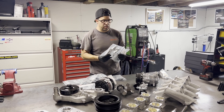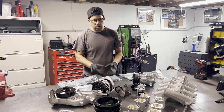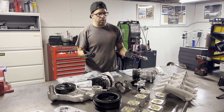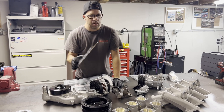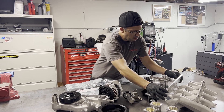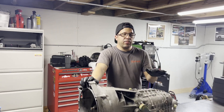We have all the ICT Billet custom brackets — not sponsored, I've just used them on past projects like the Y-body car and they make it really easy to put a small block Chevy into everything. We also have a new air compressor and all the pulleys for the system. It'll be a two-belt setup — one for the water pump and alternator, one designated for the AC. We're also doing something really cool: running individual throttle bodies just like we did on the Y-body car. For the plenums I turned to JC from JC Customs, a local CNC guy and good friend, who custom designed a backing plate for the individual throttle bodies. My buddy Tyler from Fortune Auto Design will build carbon fiber plenums for it — it's going to look really cool.